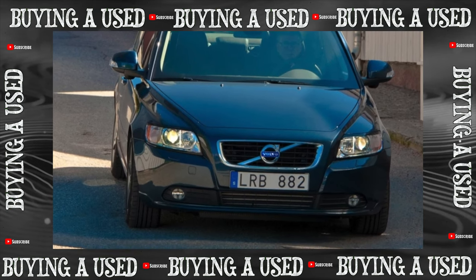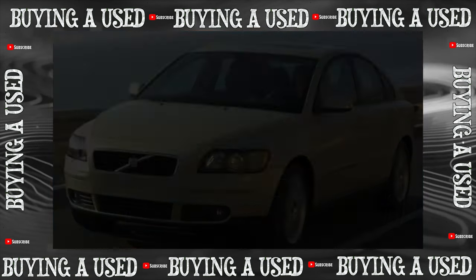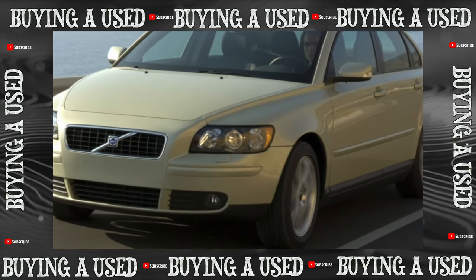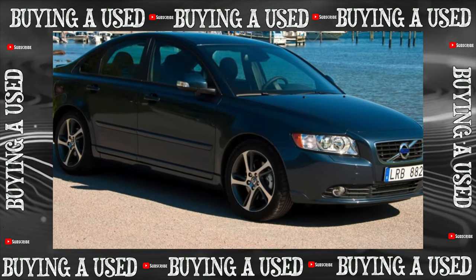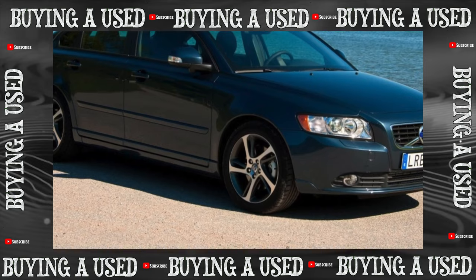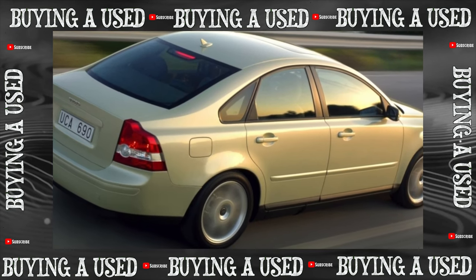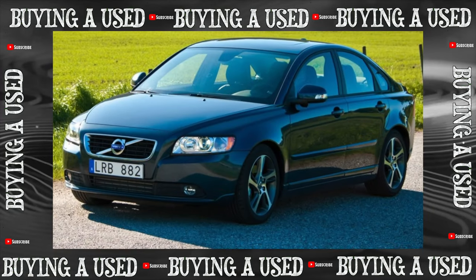Along with generic ailments, Volvo also acquired some issues from Ford. Due to a badly routed wiring harness for the electric lock drive that breaks or short-circuits after four to five years, the trunk of S40 sedans may stop opening. After 80 to 100,000 kilometers, the Bosch fuel pump in the tank may go on strike; replacing it requires removing the tank, though savvy owners have adapted to fit a cheaper assembly from the VAZ front-wheel drive. And after six or eight years, a seized radiator cooling fan can cause overheating, as its electronic control unit is mounted directly on it and suffers from dampness and salt.